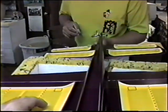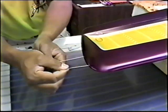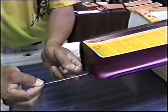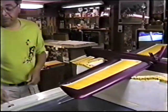Now see the elevators? These you can see. Okay. But even that, just a little bit of binding. Now feel the controls and see how nice they are. I mean, make sure there's nothing, because once you get out to the field, you're working under battlefield conditions then. Doing it in here in a shop, it's a thousand times easier. They're like glass. Okay, beautiful. All right, let's get the tailwheel wire cleaned up.